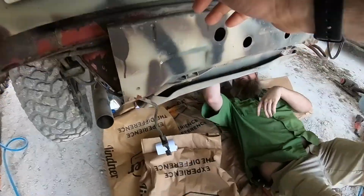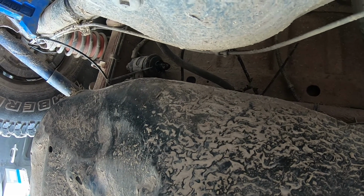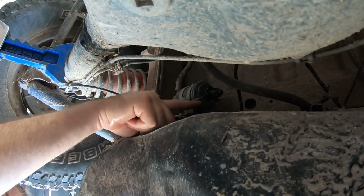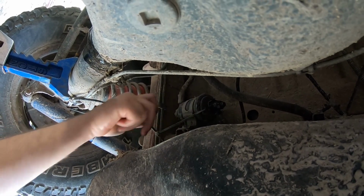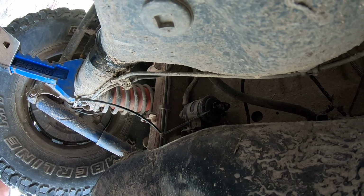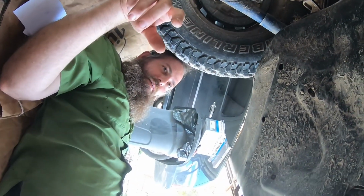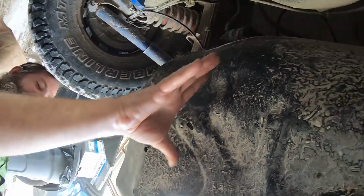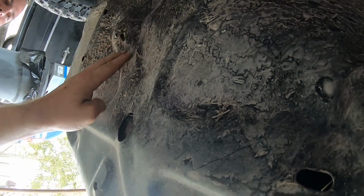All right, what's the next step, Papa? What is that? This will be a fuel filter. This is the fuel supply line. Now, since the fuel supply line runs on top of the tank, we have to disconnect it from the filter area according to the service manual. It says nothing about this giant dent. Holy smokes! Which may be the reason why it does not work.